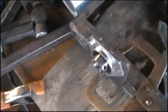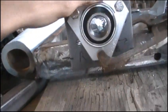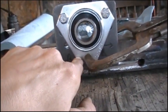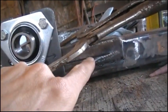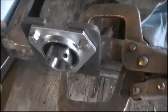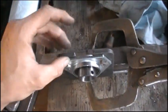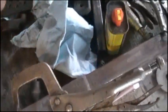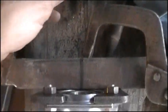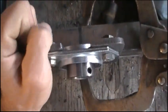On this side I'm going to mount the bearings with the flange side facing outwards. You've got one bolt here, another bolt there, and the third bolt is actually covered up by my vise grip, but it's going to go right through the center of the frame. If you remember, there's a piece of one-inch box steel jammed up inside this C-channel frame, so it's actually going to bore through about three layers of steel on one side and two layers on the other, and bolt through on the bottom. These two bolts on top will be smaller, and this whole thing is going to be welded. I'm also going to take some box steel, cut 45-degree angle pieces, and weld in little gussets on either side so there's no deflection when it's all mounted.